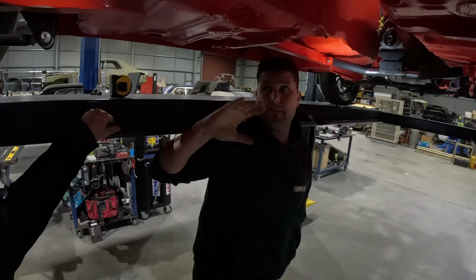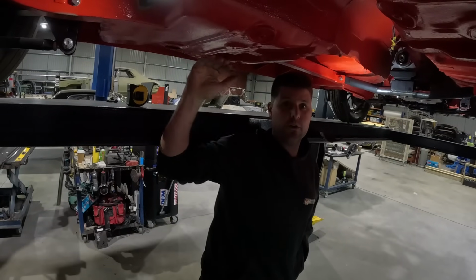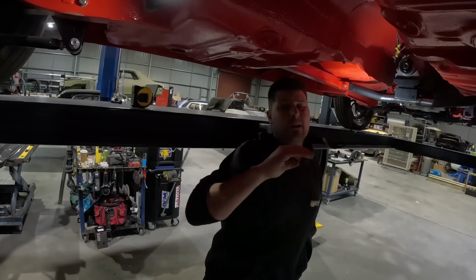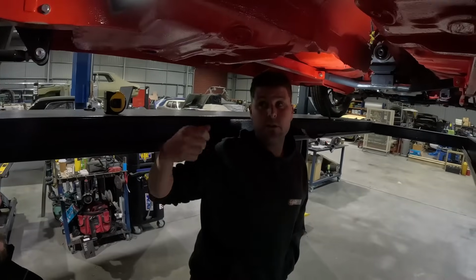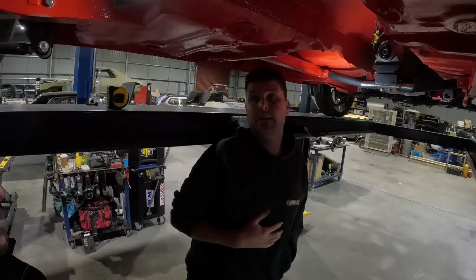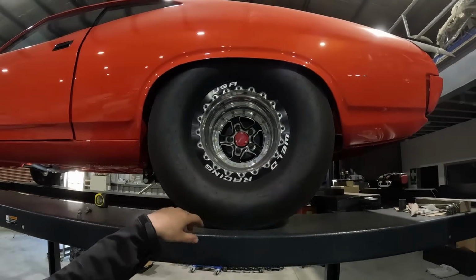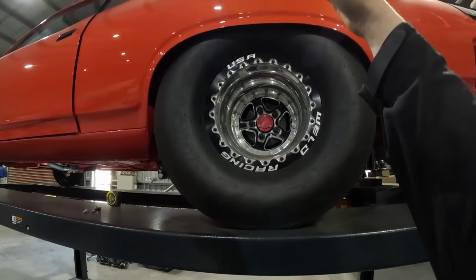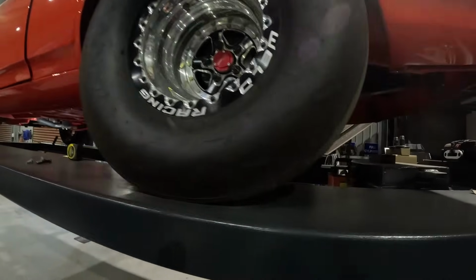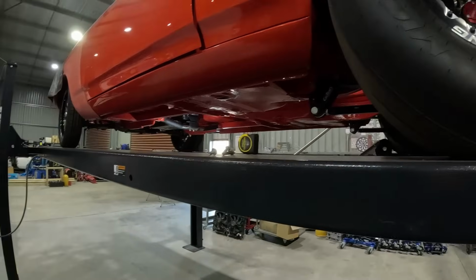And this is at ride height. That's another thing. Whenever you measure it, we want to know the measurement at ride height, so as it sits static on the ground, not on a 2-post hoist or jacked up by the body. If it's on a 2-post hoist, you can lift the diff up with no springs in it or whatnot. Measure wherever the wheel's going to sit. With this car being a leaf sprung car, obviously you can see where the tyre's sitting, but naturally when this separates and goes up, it's going to have quite a large gap on it, especially being a split mono leaf. So they actually have quite a large separation on them. So definitely don't have it on a 2-post hoist.